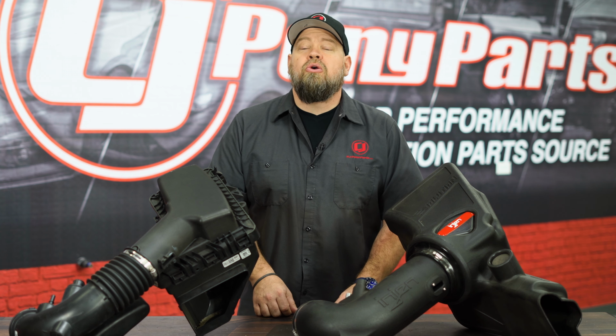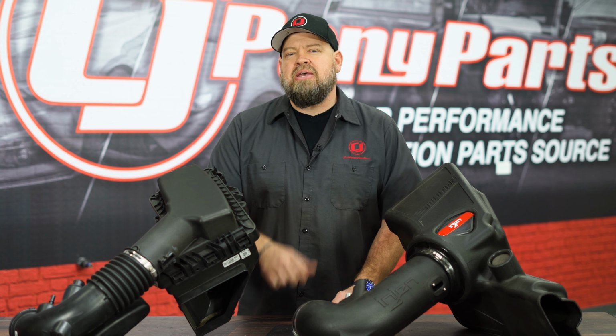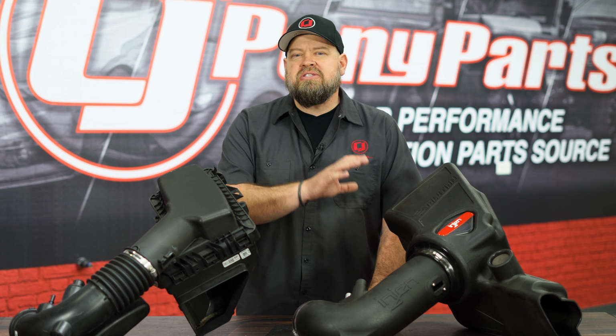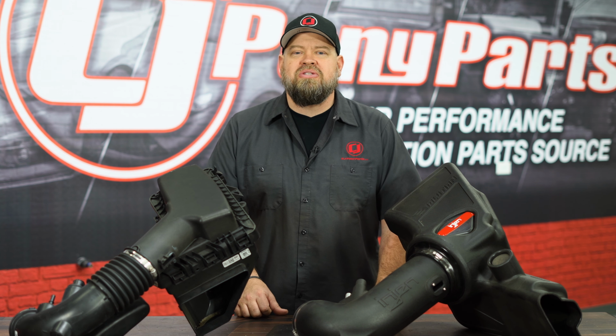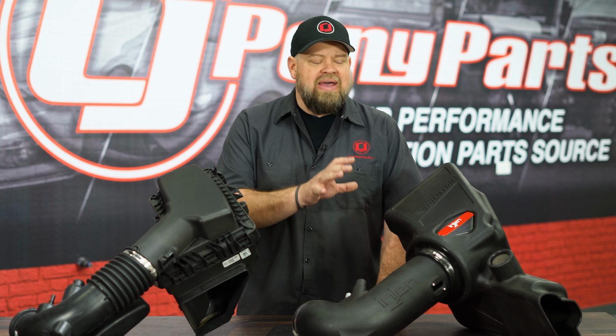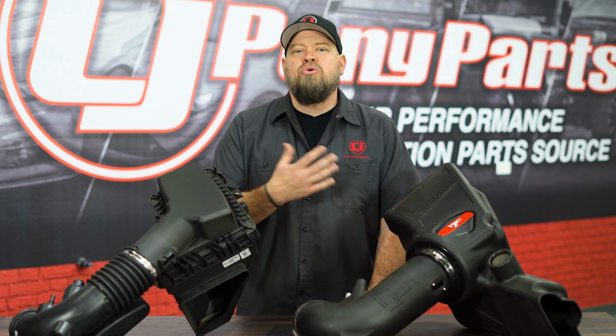The two questions we hear all the time are, can a cold air intake damage my engine and will it void my warranty? We'll start with the damage. Cold air intakes have been around for a long time, and a properly installed cold air intake is not going to cause any damage to your engine. Now, if you're going with a no tune required intake, again, it's designed to be a direct replacement for your factory intake. If you do go with one that requires a tune and you don't have the proper tune, in that case, yes, you can cause damage. So make sure when you pick out the intake, you know if it needs a tune or not and have the proper tune to go along with it.